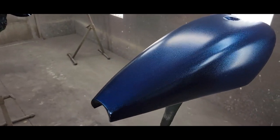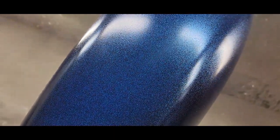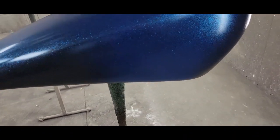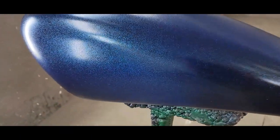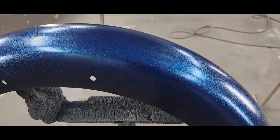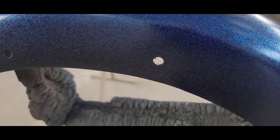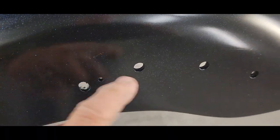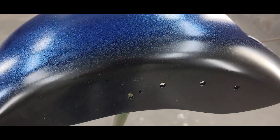Okay, I've got these done as much as I'm going to spray them with the flake. You can see some of the black showing through the flake — that's fine, it actually makes the flake sparkle more. I forgot to mention I'm also putting a stripe down the side here. I'll put about four coats of high-solids clear on here. It would actually be a pretty cool paint job if you wanted to clear it, re-sand it nice and flat, then fade black back up into it.